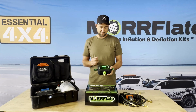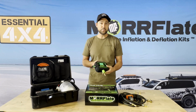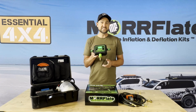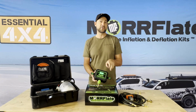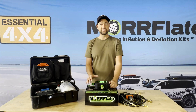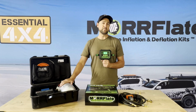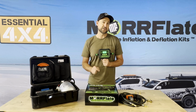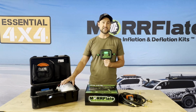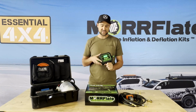Wait for it to stop flashing, plug in all of your tyres, slide your valve open, and away you go. This will now turn off your compressor, as long as your compressor has an auto cut-off function. When this stops air pumping out, your compressor will turn off. Most good compressors in the Australian market do have that, so you'll be fine.